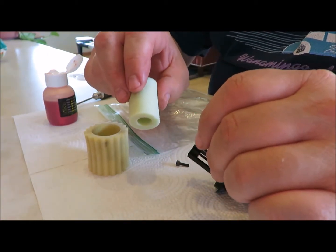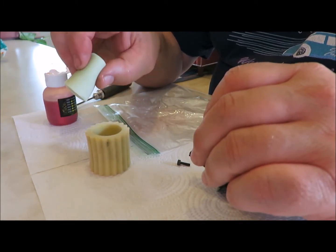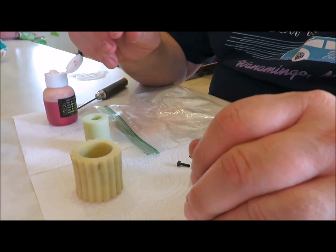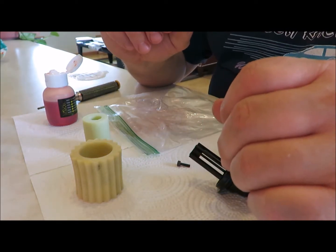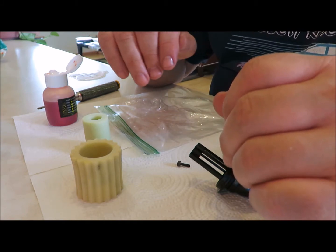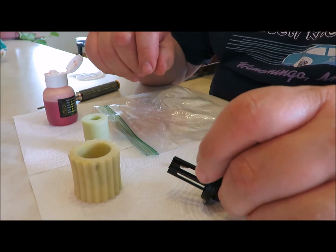I do them in the kitchen sink, use some dish detergent, rinse them out really good, let them sit overnight so they dry out good. I've never really had any problems with getting dirt in that way. If you've got a $500 engine and you want to put new ones on, that's fine too. A lot of it is on how you do your oiling of the filter and assembling the filter.